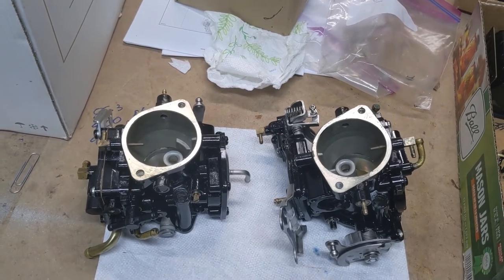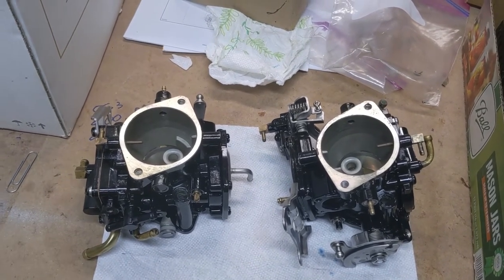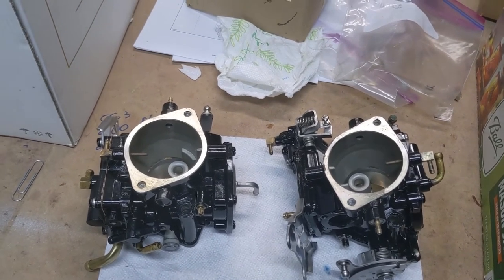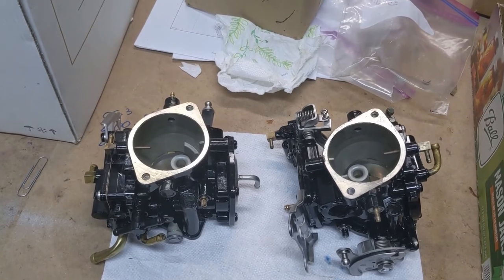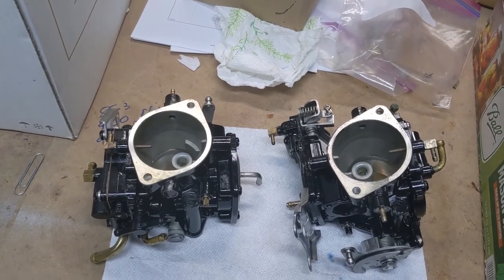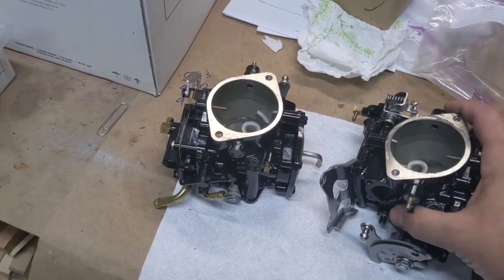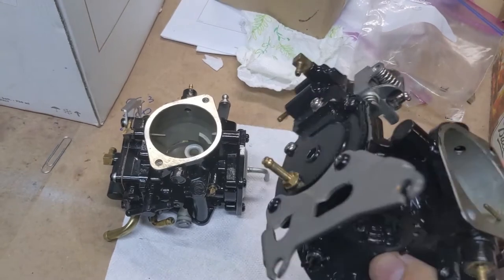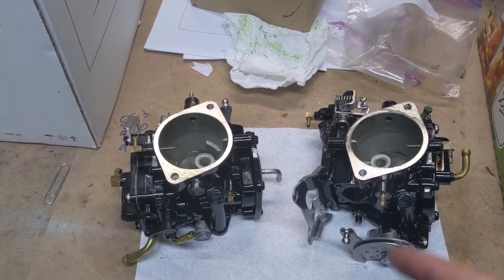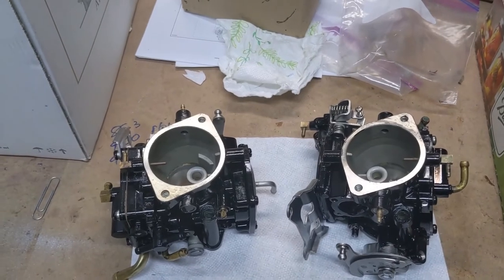I'm going to try that combination and put everything back together. I've got the brackets on, all the inside parts on — that actually came together pretty well. Now it's just a matter of putting the connector hoses on and putting the plate that holds the carbs together on. Now we're going to connect these together with our fuel line — this is fast flow. Instead of using screw clamps, which can chew into the rubber and create an imperfect seal, I'm going to use Etiker clamps. This is the preferred way to do it — they're OEM and perfectly round. You need a tool to crimp them, or you can use diagonal wire cutters.